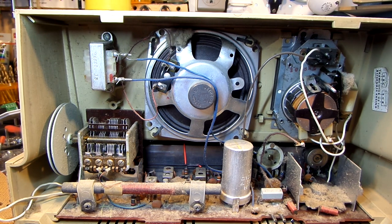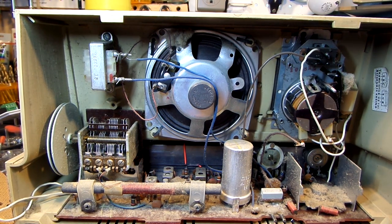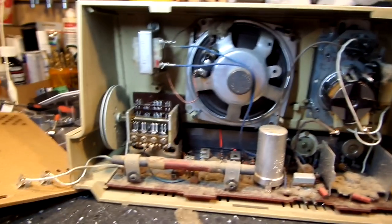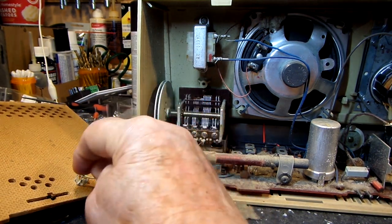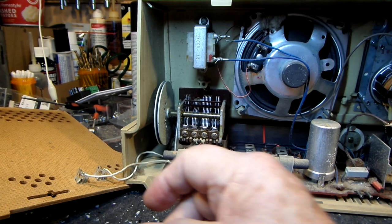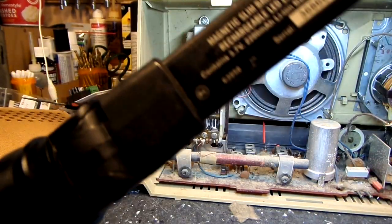And that's what I'm going to do next — see if I can't separate the chassis from the cabinet. I'm going to take the knobs off. I think the chassis slides out this way and this way over here. I'll have to probably remove and unsolder the FM antenna wires — they're soldered on. Once I get the chassis out, I'll take my brush and air and things like that and clean it out as much as I can.